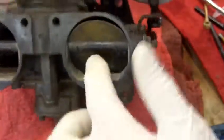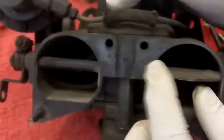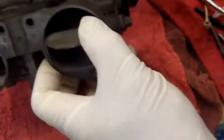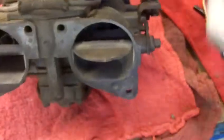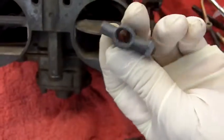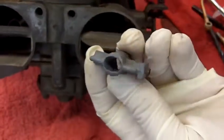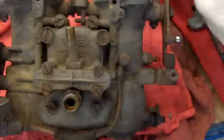In order to get to that point, we either have to remove your choke butterfly and choke shaft, and then once that's out of the way, the Venturi — and behind it there's a pre-atomizer. This one's been all beat up, but that pre-atomizer is in there and it has to come out, and then the Venturi can slide out.